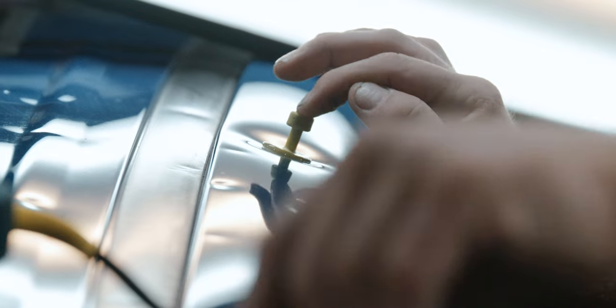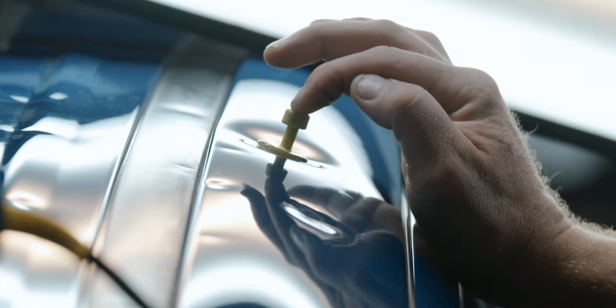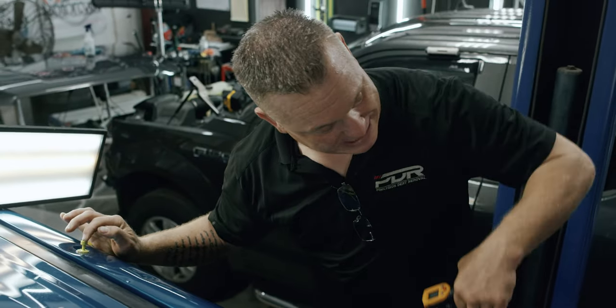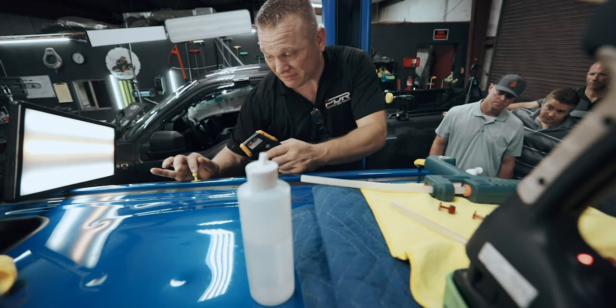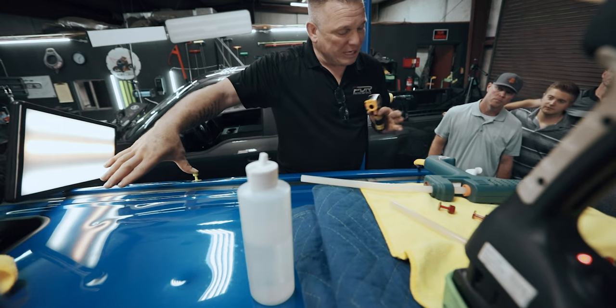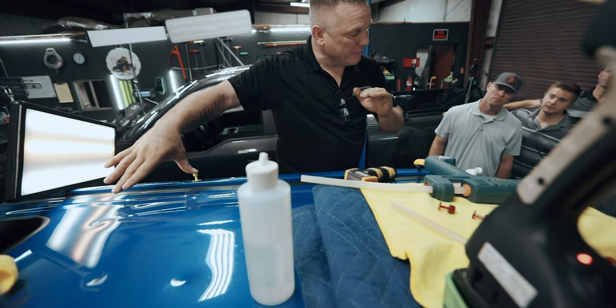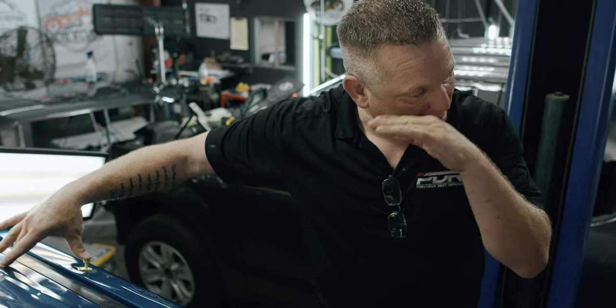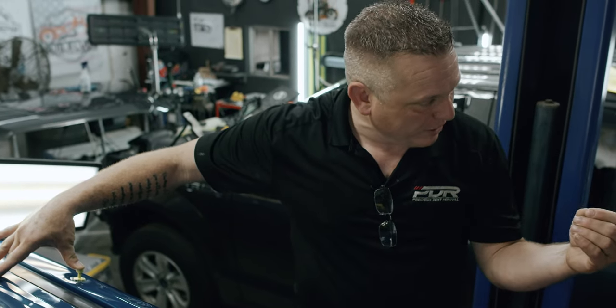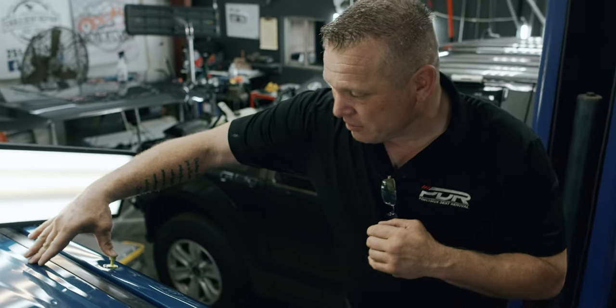Now, I'm pushing that in there to get that stem, because where's the pull power? It's in the stem. You got it. All right, so now I've got great bond line around it, but because it is a longer set time, if I let up, I don't want to have a vacuum in that pit. So I'm keeping pressure on it, okay, until I get the cure.